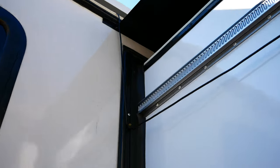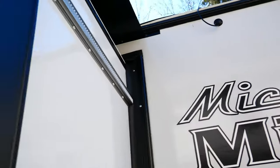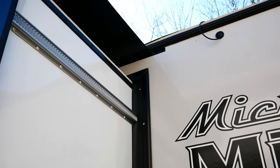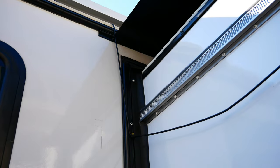While I was up there, I noticed there's a screw that's actually pulled through the rubber, so I'm going to throw that out and put a stainless steel washer there. On the other side it hasn't happened yet, but I can see the screw, so I want to fix it before it rips the rubber more. Then I'm going to make the slide go in and out a couple of times to get the gears lubed as well. That is done.